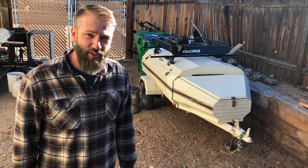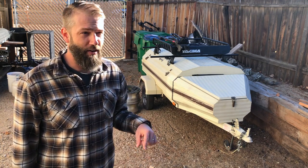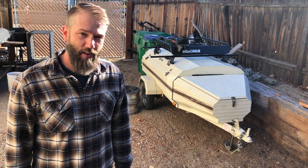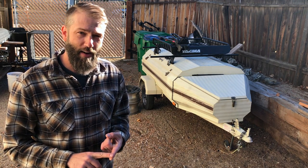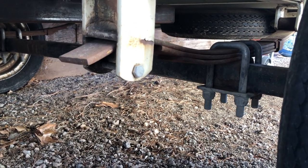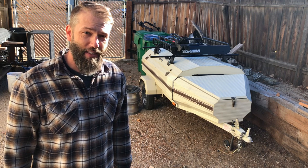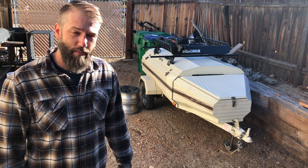It's got a couple of issues, a couple of things that need fixing right now. As soon as I drop the kids off at school I'm gonna come back, hook it up, and drag it downtown to a place called Crow Belt in Reno. They're going to cut off the springs and spring mounts. Right now it has slipper springs — an eyelet in the front and then it just slips against the trailer body in the back — which makes a lot of noise and bounces down the road. They're going to put on full long springs with shackles and eyelets at both ends.